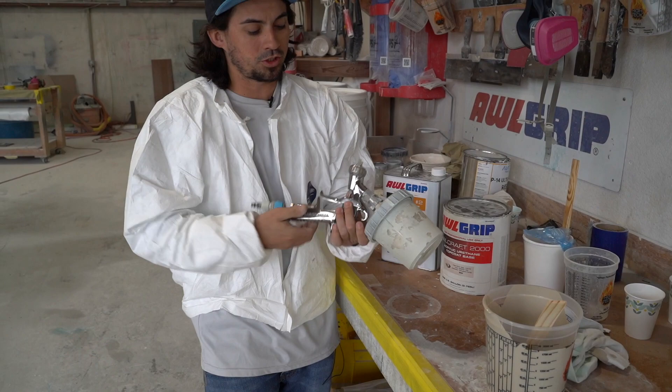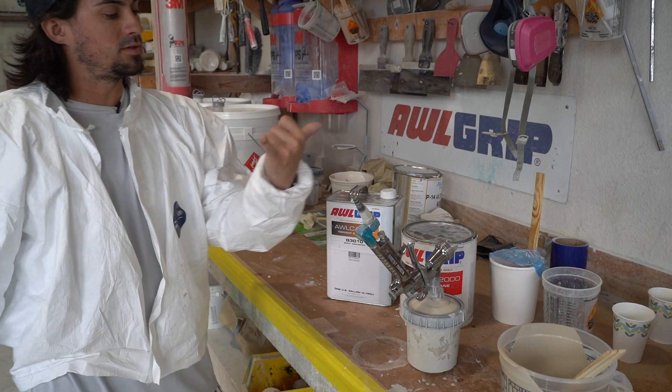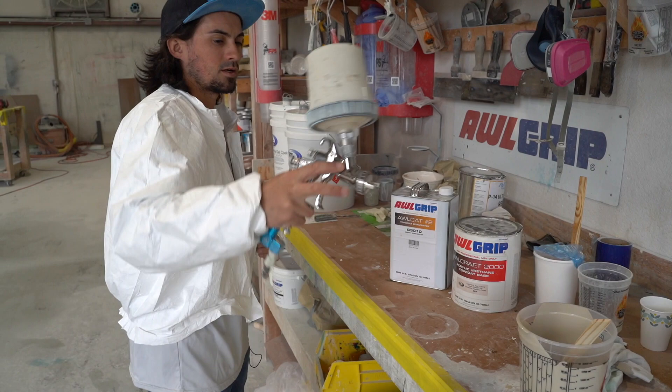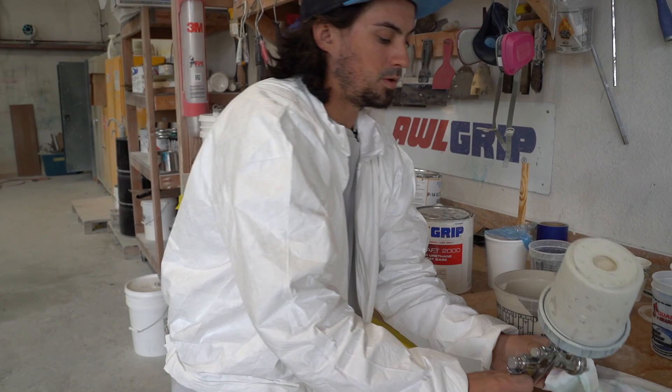We like to have a nice fan set up — nothing too big. It depends on where you're shooting to how big you want the fan. That's about the distance you want from the part you're spraying, and that's about the fan you want. Every pass, I like to start from where I started, come back and do a nice 50-50 overlap. We've got a 1.4 tip on here, which is a nice tip to spray paint with. On the end of our airline we have a pressure gauge — we usually keep it around 25-30 PSI.